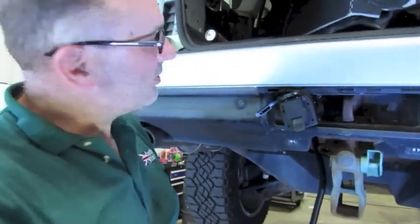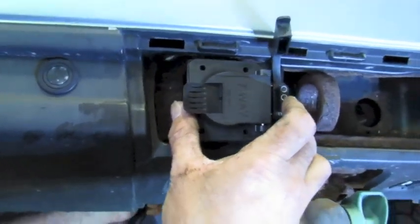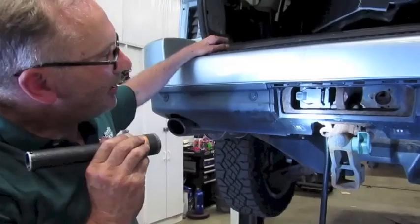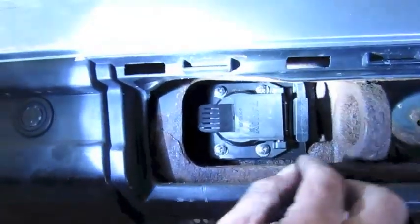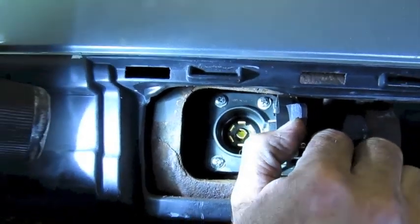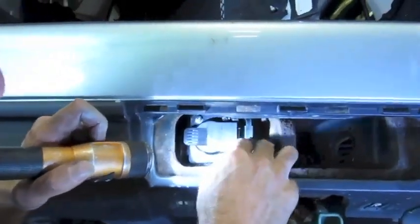Here we have the new unit semi-installed. The orientation for the trailer socket is like so when it's inside. It can get a bit fiddly trying to install it through the small area, but it will go — it just takes a little time working it up and down into the back of the vehicle. Once it's in you can screw it in securely. Here we have the new seven way trailer wiring connector installed, screwed in tight — there's the four pin, there's the seven pin, all four screws are in. The silver stuff around the screws is anti-seize compound, because these have a tendency to get tight and corrode, especially being exposed to the elements. Definitely advise putting anti-seize compound on it. It's properly installed into the back of the bumper.